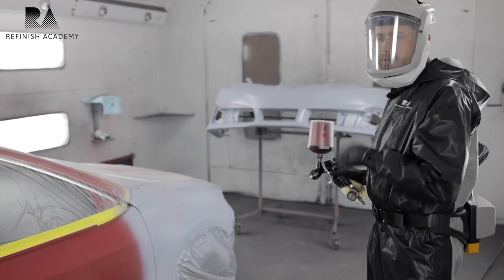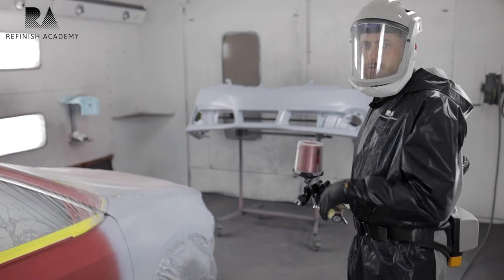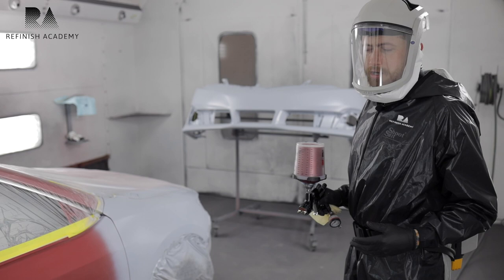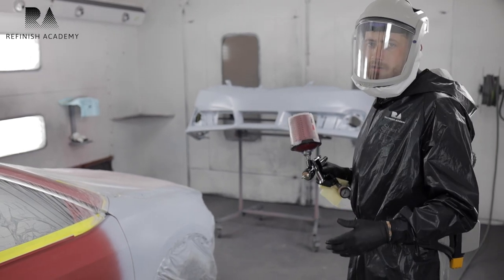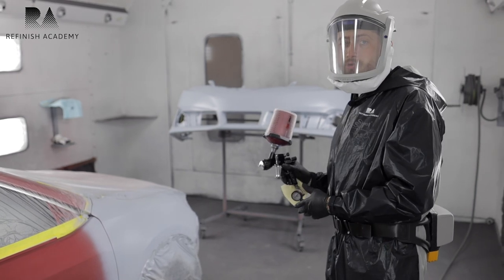to get that on that bumper immediately. I wiped, plugged the holes, got my sealer on. While my sealer was flashing, I went and made my base, I strained it. So I've already got my color. Otherwise, I would have started spraying my color out immediately, probably when I sealed it. That way I'm two coats ahead of what I'm gonna put on the actual car.